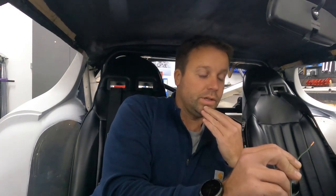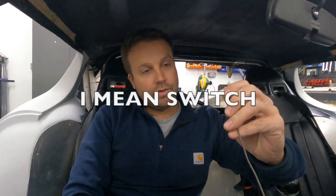Turned them off again, replaced the fuse, turned them on, let them run, turned them off, touched this to the fast position - and they parked. They parked faster. So they park. I haven't held this to the fast position and turned them on again because I know it'll blow the fuse - same thing. So I've replaced the fuses. What I need to do is have this wire attached to ignition, but only when the switch is in the off position. I'm racking my brains as to how to do that. I'll put some tape on the spindle, show you the camera, and demonstrate that they do park when this wire is connected to fast or slow while the switch is off.